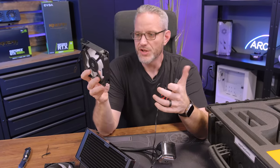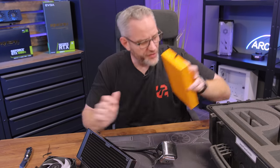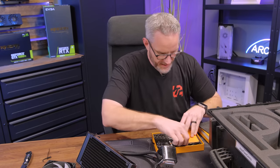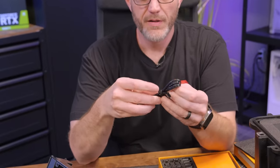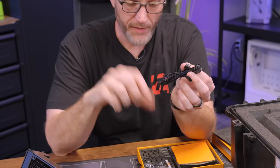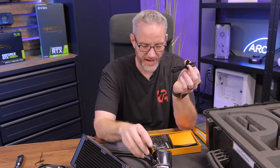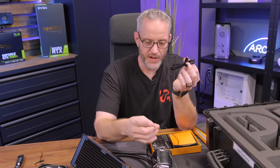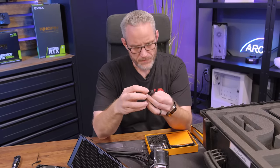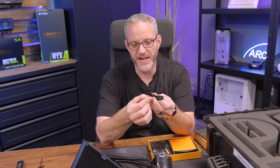I'm still not entirely sure how we would control any sort of lighting on this, unless this also has an RGB header on it. It was in the middle — okay, cool. So no proprietary software needed to control this. The pump gets controlled purely by the PWM slash fan header, whichever you plug it into, and then your ARGB right there. And then your fans use the proprietary plug on this end, and then both a fan header and an ARGB on that end.